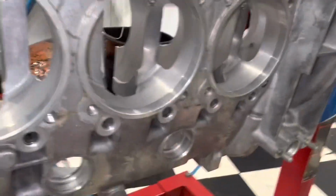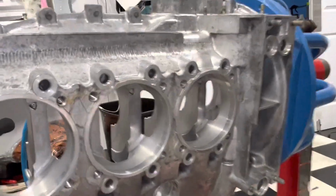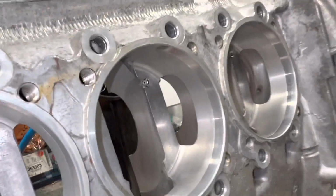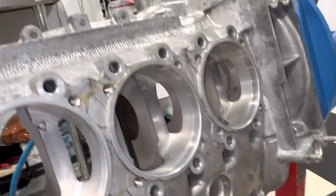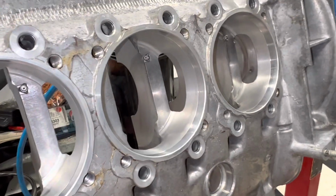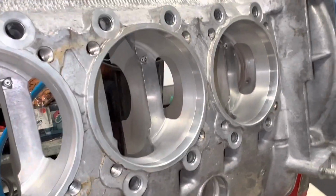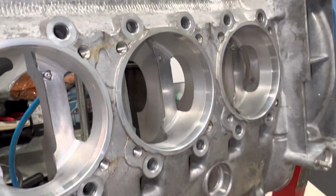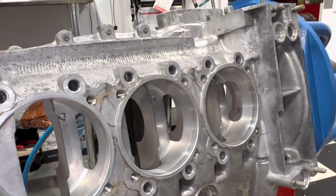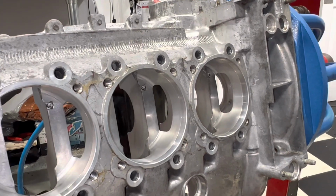But yeah, you're talking about stuff that gets really hot, and you've got to make sure that these guys are working, because if they're clogged, you seize a piston, break a rod, have a big window in the side of your fancy engine case, and it's a bad day. But let's end it on a good thing, because so far we've done 2 squirters. Both squirters work perfectly. That's fantastic.